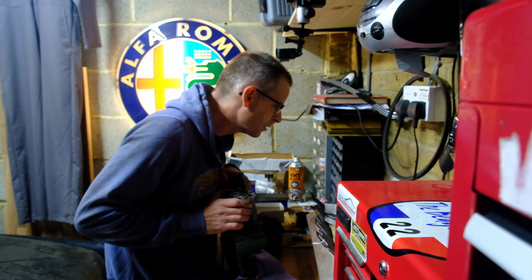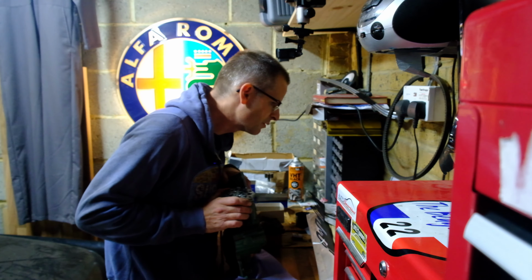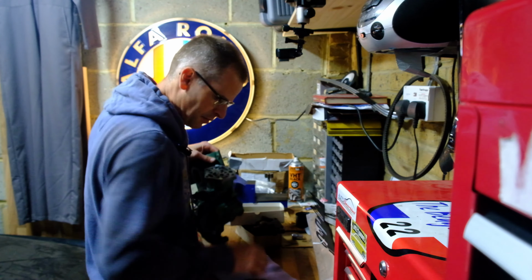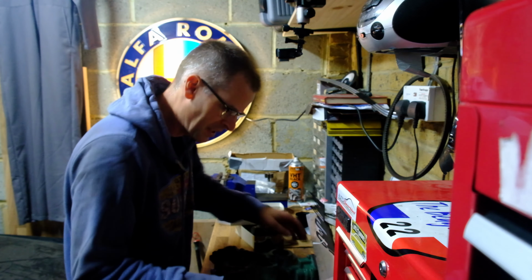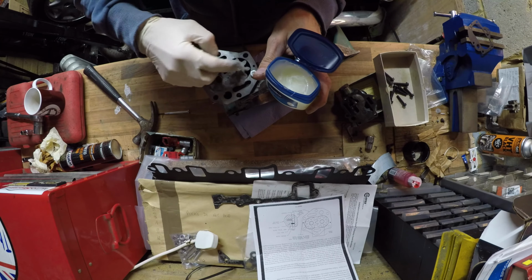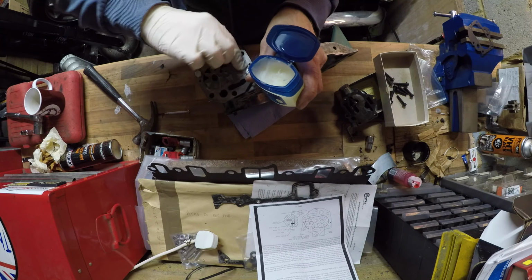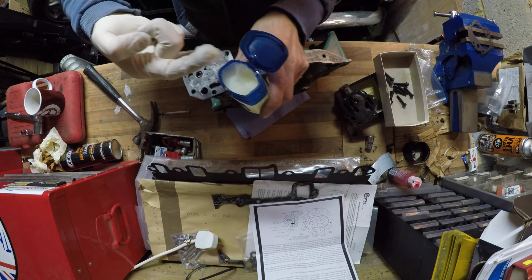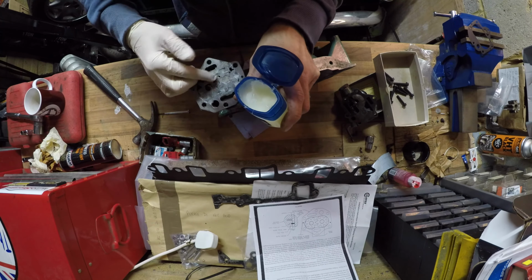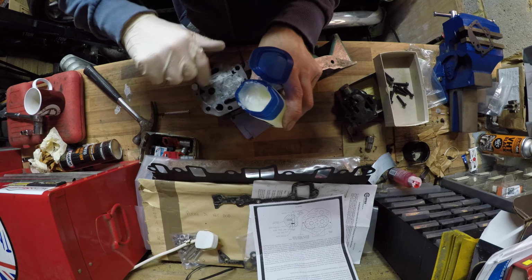Remove the quarter-20 by 5/8 bolt and pack the pump full of Vaseline, level with the end of the gears. Now I think I'm actually going to do that the other way around. I'm going to do the pump packing with Vaseline first and keep everything in place. Suddenly I feel like David Freiberger packing grease into a wheel bearing, which I seem to do in every junkyard rescue. It's always a wheel bearing needs packing. Now, apparently this needs to be completely, utterly stuffed so there's no air pockets, so when the engine turns for the first time it creates suction and draws oil through.